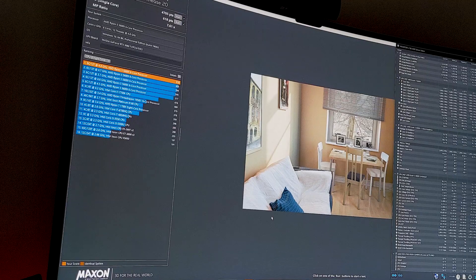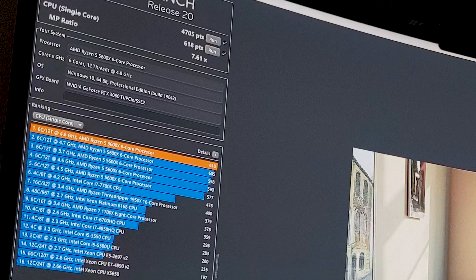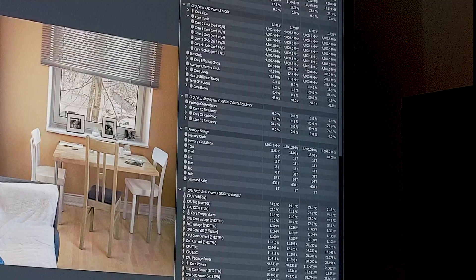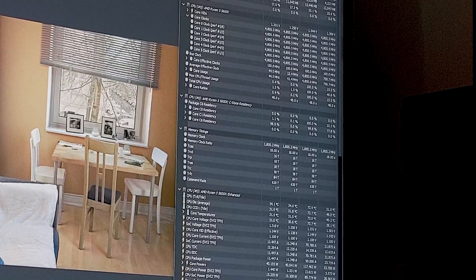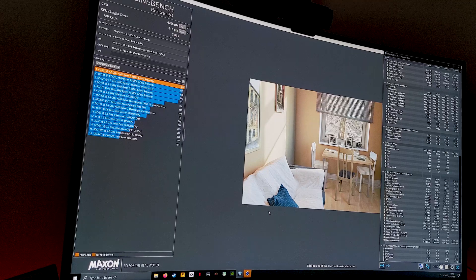I think I've reached my final overclock for the 5600X. I've managed to achieve 4.8GHz at 1.325 volts, with a multi-threaded score of 4,705 points and a single-threaded score of 618 points. So today I have actually managed to beat PBO. Looking at our CPU stats, we were hitting around 72.9°C — well within margin of what we had with PBO — and much like PBO we were pulling around 117 watts. I did try 1.3 volts but we crashed, so I had to bump it up slightly. There could potentially be more performance on the table, but for now we've beaten our original score, so I'll call it a day on that.